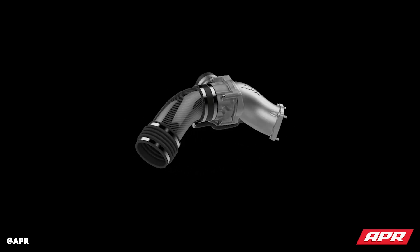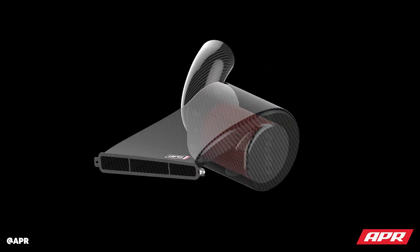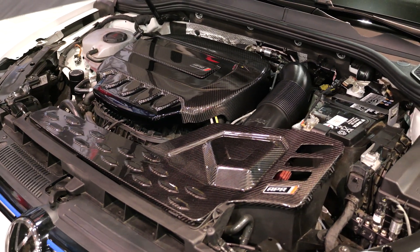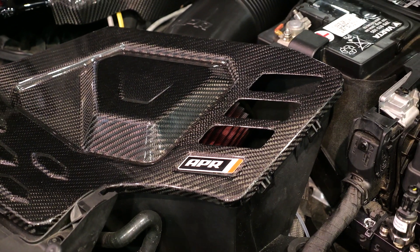At some point you reach the limit of factory hardware — the intake, intercooler, turbocharger, and exhaust. We're standing in front of a turbo and manifold here. The first thing people do is upgrade the intake system to get more air in and lower the pressure in front of the turbo. After that we look at the intercooler, and eventually you top out on the turbo itself. We monitor shaft speed to make sure we're not over-spinning to the point of turbo failure. Once we reach that limit, that's the end of the base calibration — what we call a Stage 3 calibration, which involves a turbocharger upgrade.